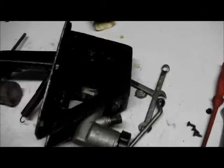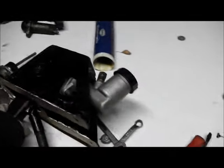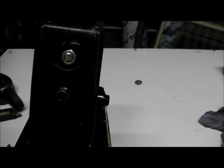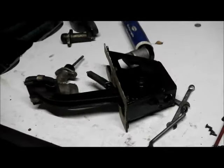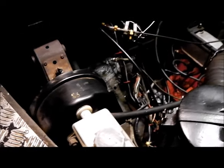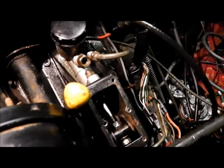Here's the new master cylinder fitted to the pedal tower. I've just put the gasket on the bottom of it with silicone sealant so it'll stick, and I'll smear some grease on there so it sticks down well enough on the bodywork. I can get a socket in there no trouble - really pleased with that modification. I've greased and oiled everything up but left the linkage loose for now - I actually forgot to measure it before I took it off, which is something you should do, but it'll be easy enough to find the setting again. The bodywork is tidied up a bit here now. We've dropped the pedal in - same procedure as disassembly, a bit fiddly but not too tricky. I've dropped a screwdriver in one of the bolt holes to keep it in position, then put the bolts in loosely, and we'll put the hydraulic union on before tightening everything up.